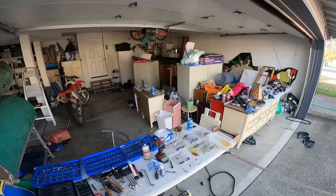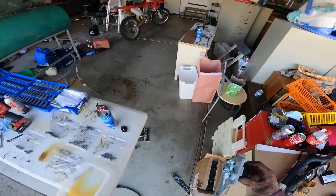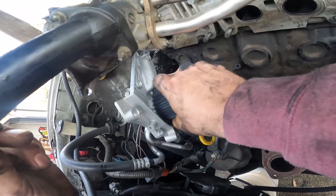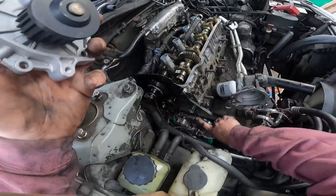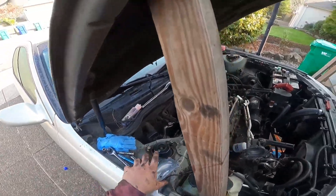Grabbed the new water pump. So just by the way, there is a little gasket, an O-ring on the back of this right here. You can see it right there. Don't forget to replace that. Don't forget to clean off the surfaces that it mounts to, because that O-ring seals up this hole right here.